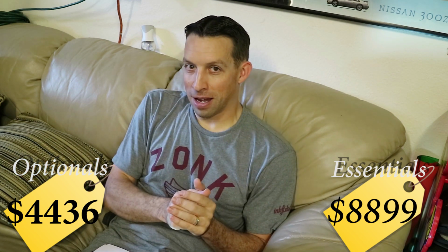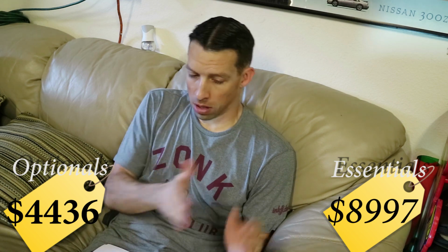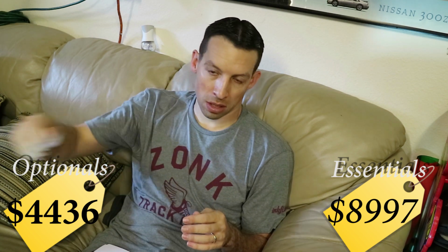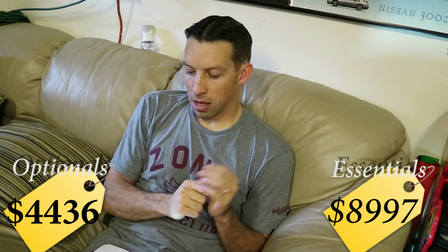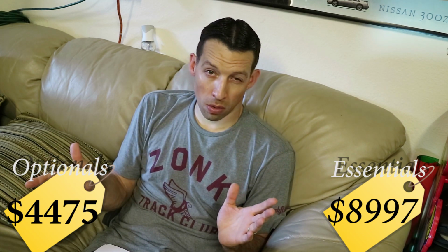As advertised, the McKinney Motor Mounts kit does not require any modification of the transmission. However, we've seen that needed to happen. All I had to do was have a drive shaft shop take out a little bit of my drive shaft. That cost me $98. We'll put that over here because that was needed. I didn't have an existing clutch line system, so I needed a one-piece stainless steel clutch line to get from the master to the slave clutch cylinder. That was $39 through Concept Z Performance. We'll put that over here. Maybe your car is already a 5-speed.